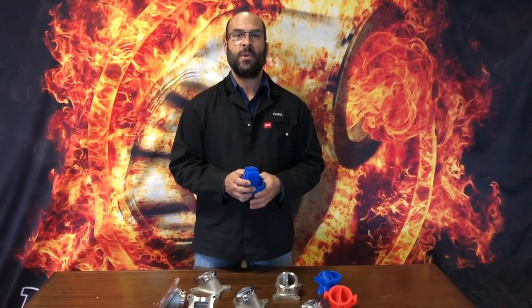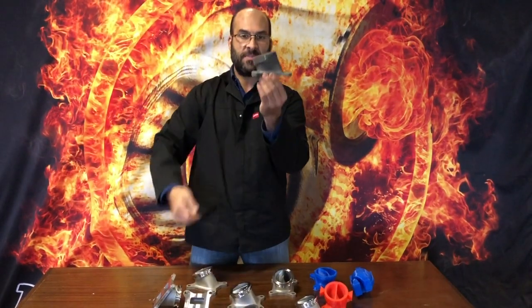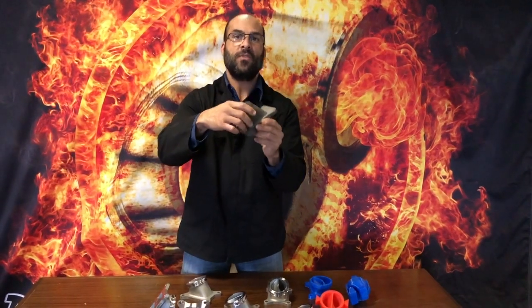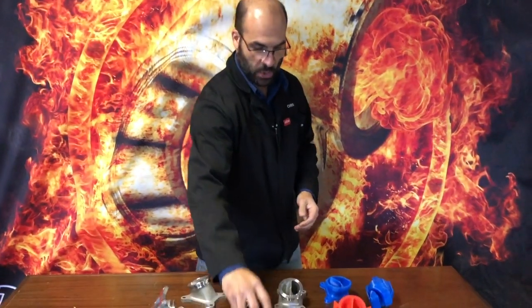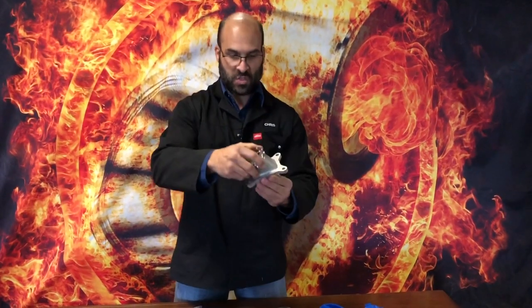We then went into making a mold — a one-off mold — so we could make a casting. We got something that looked like that, which was obviously not a final product and had quite a lot of flaws, which we ironed out. We started coming toward a better product: another single mold made from a 3D print, which we then machined, verified sizes on, and finally machined our own mold, going into production with an investment cast swirl adapter.